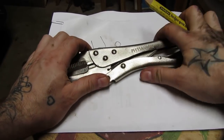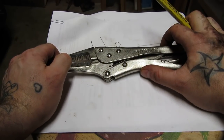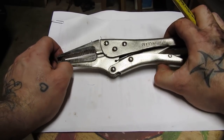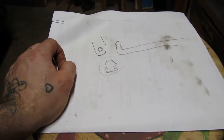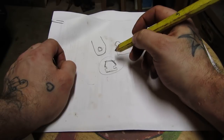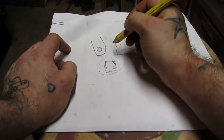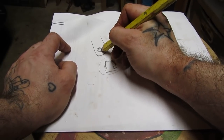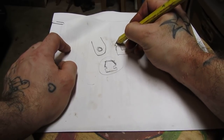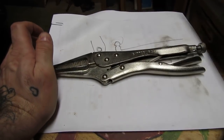The thing I used was these vise grips right here. These were about $5 at Harbor Freight — Pittsburgh brand. I'm sure there are other ways to do it, but this is how I did it. Another thing: maybe take your drive shaft out; I think that would have made things a lot easier and I could have got different tools in there. The long and short of it is I was able to press the tapered end of the bushing into this side. It'll be obvious which side because one side is bowled out and the other isn't. Once you have that in, that's the hard part — that's what took me 44 minutes. Then it took one minute to grease up the nipple-looking fitting and press it into the other side, again using the vise grips.